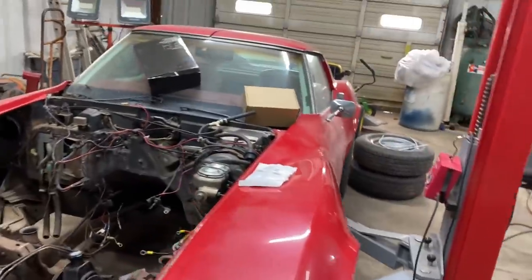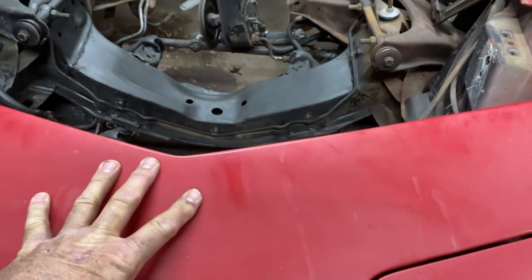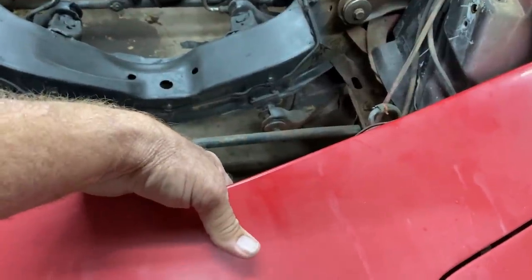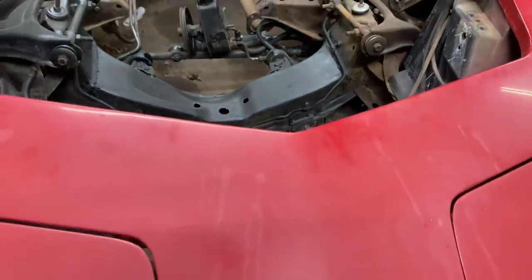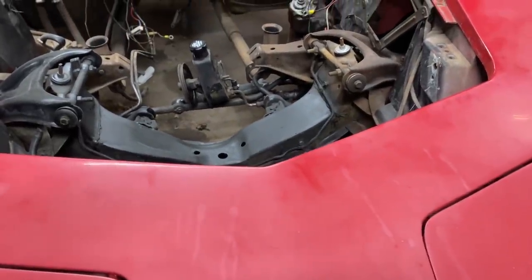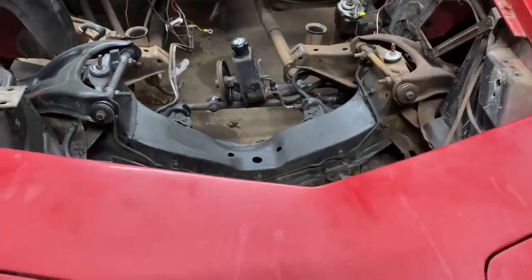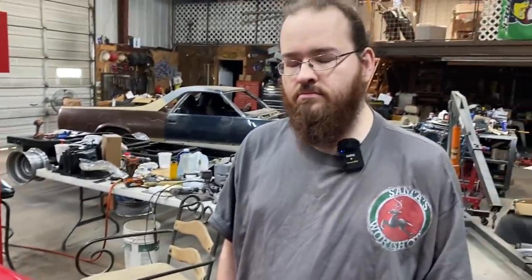Okay. We found out what's going on with the headlights. I've got the correct rebuild kit for the actuators. I've got two new vacuum relays coming. From everything I have seen, that's all these need, because when I first got it running, I would pull the switch, they would come up and then go back down. It was like there was a little bit getting through, but not quite enough.